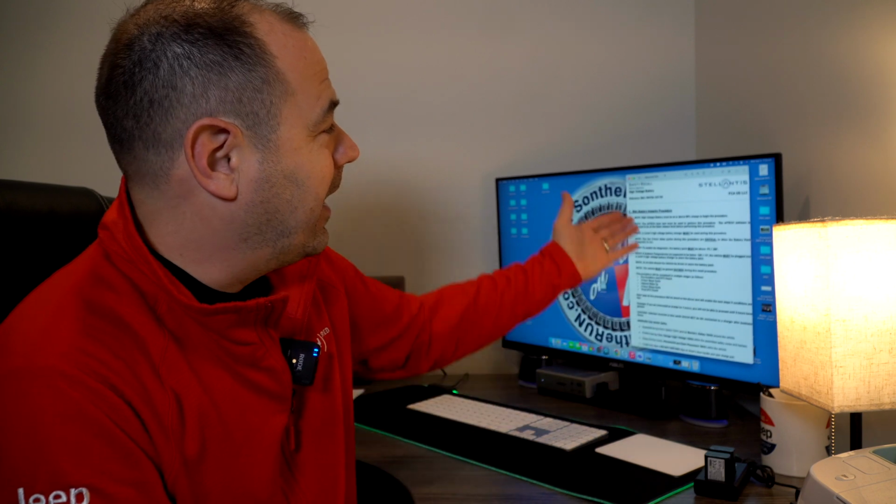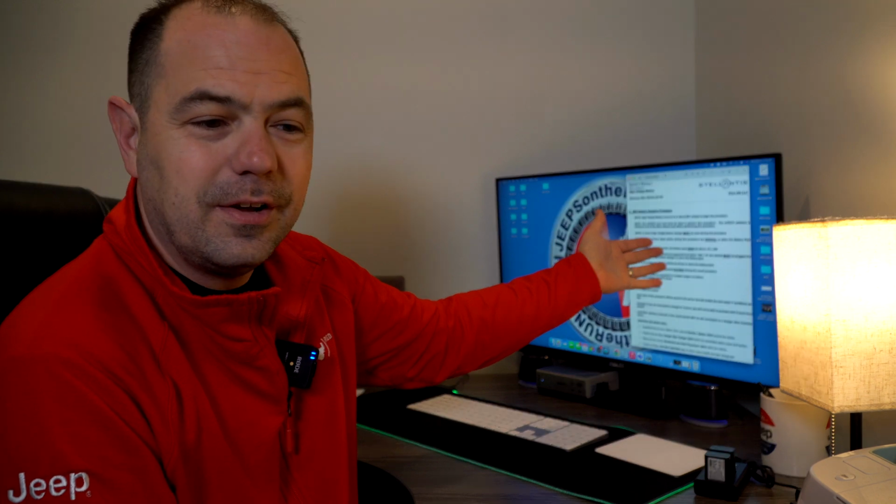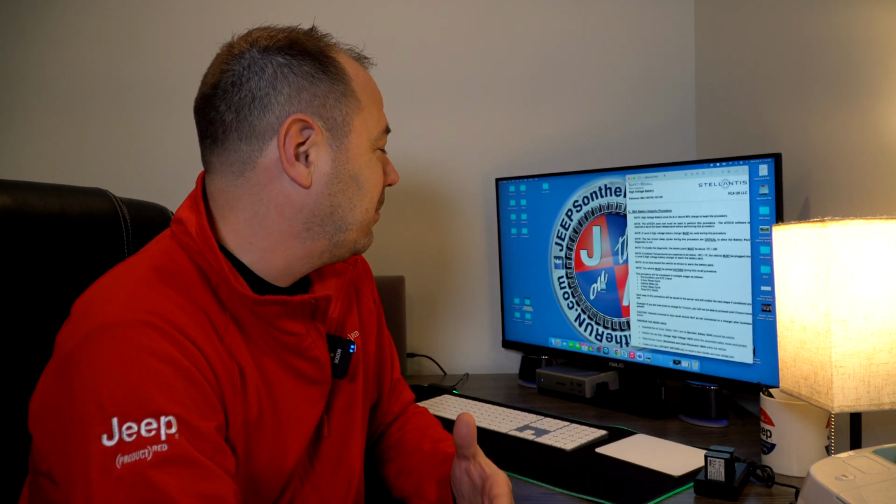So in my head, this test should take a minimum of 6 hours, and that's assuming they pull your vehicle right in, that's assuming your battery is charged, and that's assuming a perfect world scenario that you pull in and they just start it immediately. Those of you who are saying that your vehicle was done in just a couple hours, again, I'm not a mechanic, I'm not a Jeep tech, but I am reading the literal step-by-step directions for the B9a battery integrity procedure. It doesn't make sense to me how some of these dealerships are getting it done in under 6 hours. Again, if you're a tech and you're watching this, please call me out if this isn't accurate. Obviously, our goal here is always to bring accurate information to the channel.